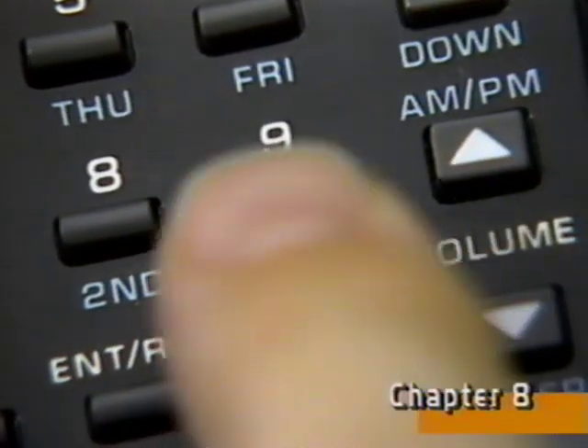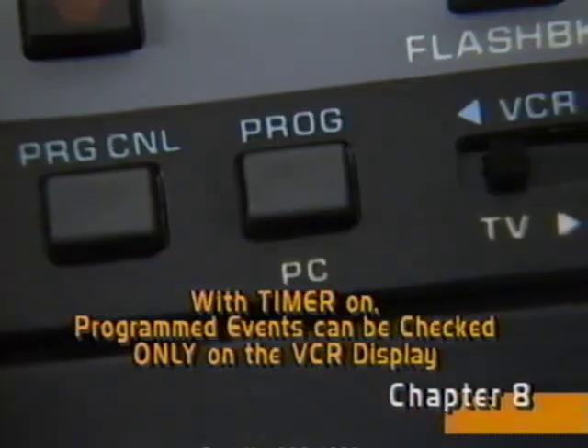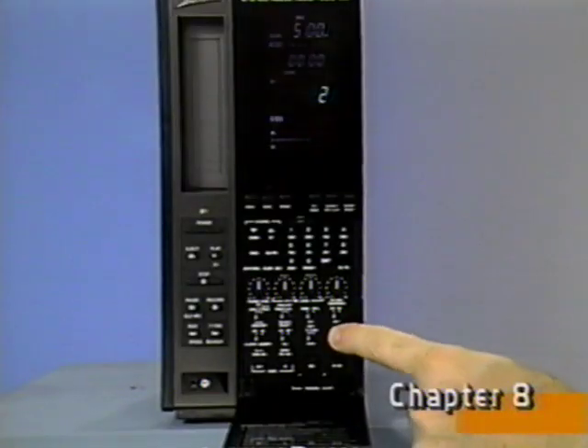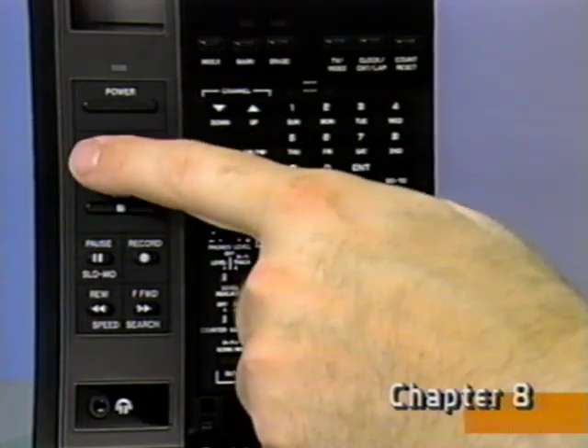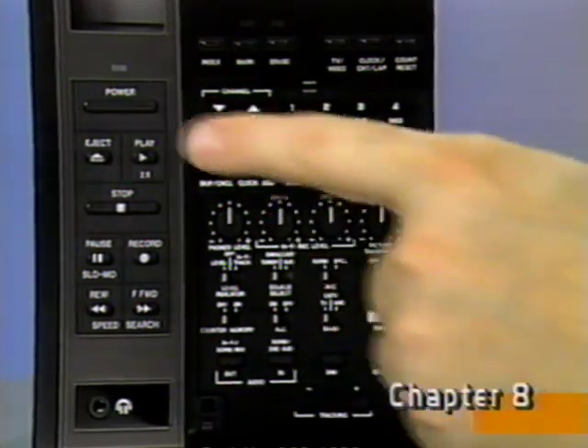To record your favorite daily series, press daily. Every day of the week will be displayed. Press daily again to remove Sunday and Saturday if desired, then press enter. Once the timer is set, you can check the start and stop times entered for each event by pressing the program button to sequence through each event and display the information. It's important to note that when the clock and timer are displayed together, normal VCR controls will not work. To make them work again, turn the timer off and press power for normal operation.